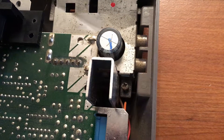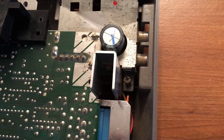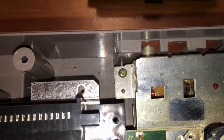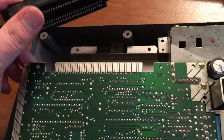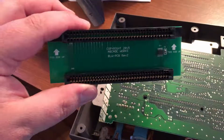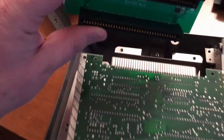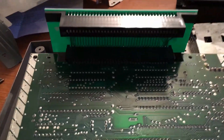When taking the shield off there's a screw down there that I missed — that one also has to come off to get the 72-pin connector off. There's another one right back there that's hard to see, bringing it to nine total screws. You just want to lift the motherboard out a little bit, grab ahold of the connector, and pull it off. It can be kind of difficult — might require both hands, but it will come off. When you install the new one from the Blinking Light Win, it even has little arrows that say 'this side up,' and those little teeth just slide right on.